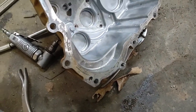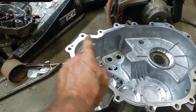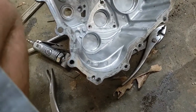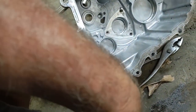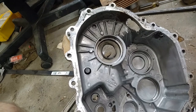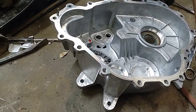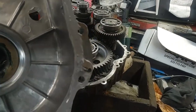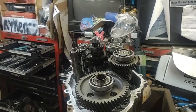The only other thing you've got to take off this old case to put on the new one, unless yours got hung in the other side, is these little dowels. There's two dowels - one here and one up on the other side over there. I'm going to tell you, these things are not the easiest thing to get out. I ended up catching it with some vice grips, twisting it, got it to break loose. One of them pulled out with the vice grips fairly easy; the other one I ended up having to heat it up to get it to come out. We're going to try to slide this cover back on - let me get that straightened up and I'll cut the camera back on.